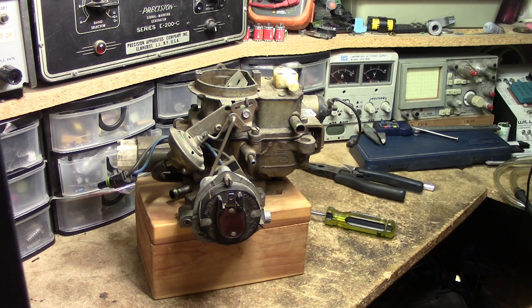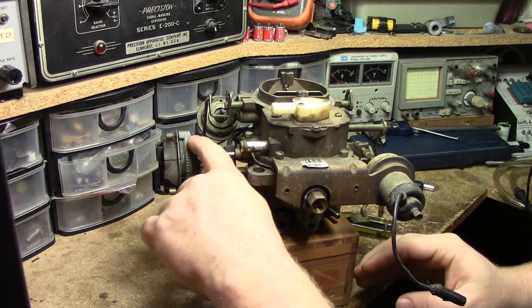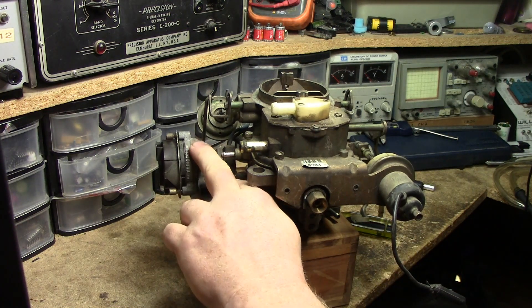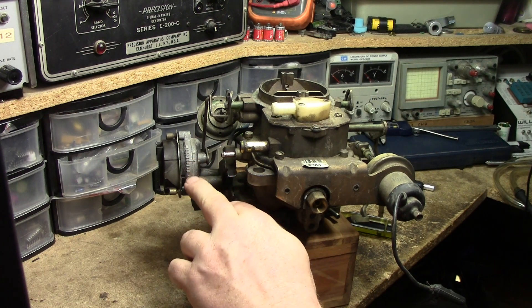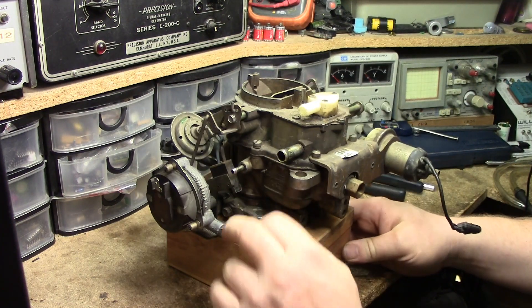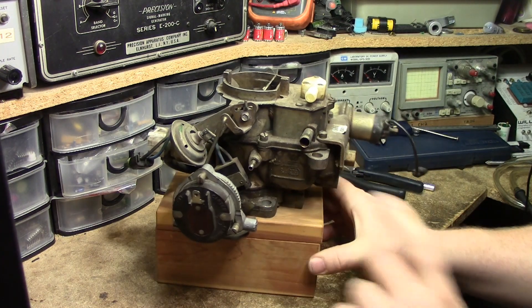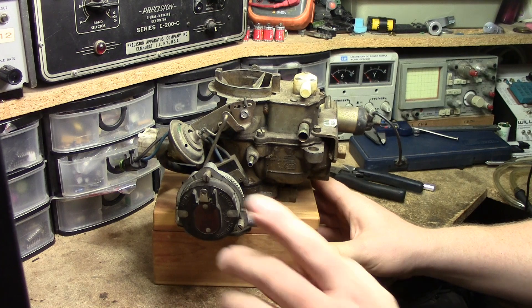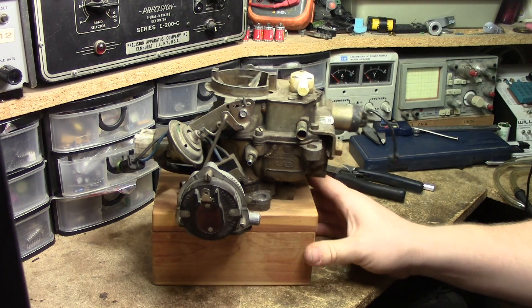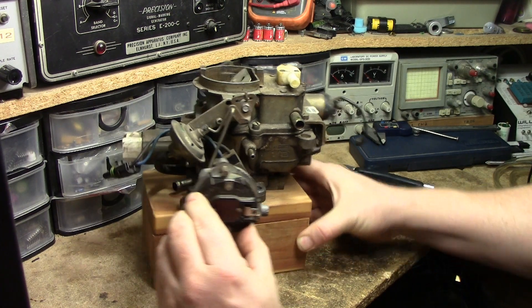What the heck is that? Some people say there's a notch or a mark, because if you look on the casting of the electric choke housing, we have a bunch of small little marks, a large mark right there, and a bunch of small ones there. You have to line up a mark on the side of the housing — you do, but not yet — because these new housings, or a housing that's never been messed with, doesn't have any notches or marks on it already. So what we're going to do is just take it and rotate it to the 3 o'clock position.